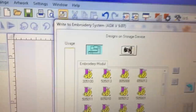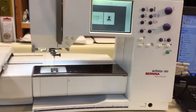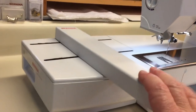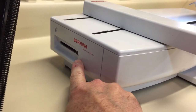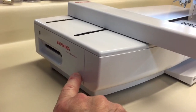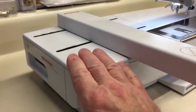This brings up a subject on the embroidery modules. On the 180 systems — 165, 170, 185 — the memory for these modules is in the circuitry in the module itself. Usually they're marked with a sticker. If you have a module that has memory in it, it's going to be marked with a sticker — you might have a 2 megabyte module, you might have a 4 megabyte module, and that's how much memory is built into the module. In this case there's no sticker on here — your sticker could have fallen off, so that's something you'd have to check.